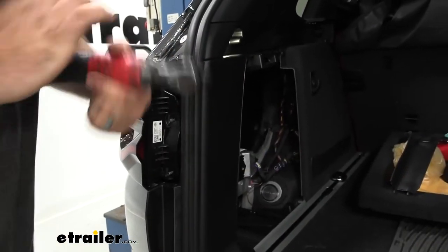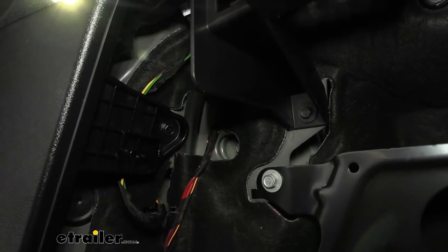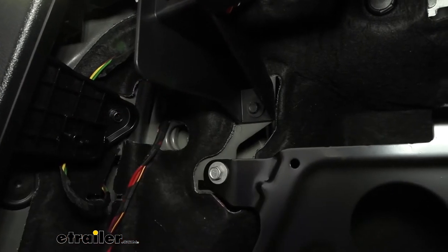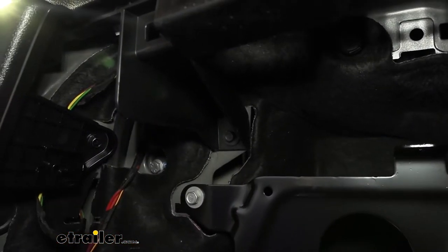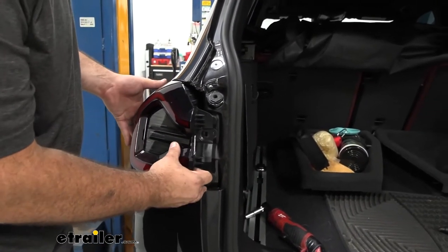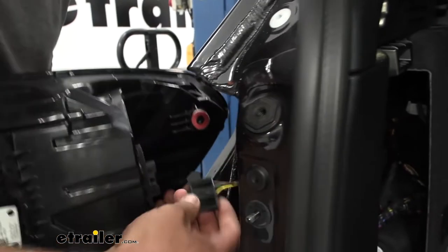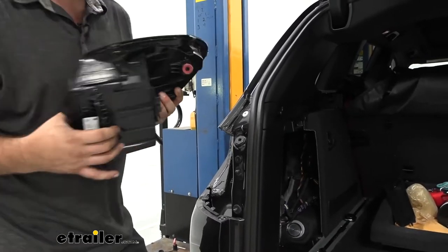With those two taken out, there's also a 10mm bolt in this cutout here that holds the taillight in as well, so go ahead and get that removed. Be careful not to drop it — I suggest having a magnet close by as you loosen it so it doesn't fall into the plastic and get lost. Now we can take our taillight and pull it back — sometimes it catches on threads, so pry slowly. Don't pull too far because there's a taillight plug that you'll need to disconnect by pushing the tab to separate it.